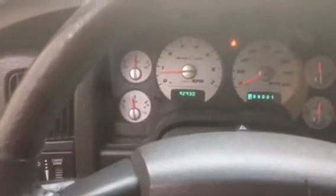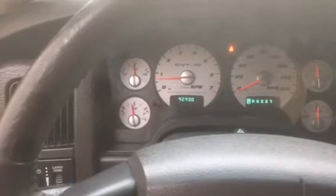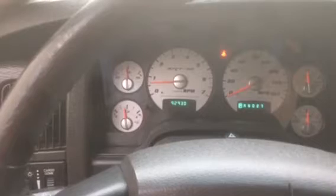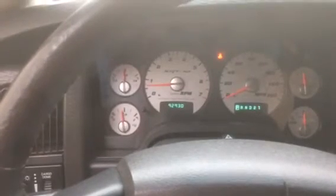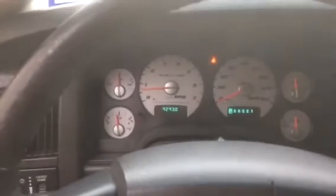Hey, it's Scott with MS1 Racing here with Rene's 05 Silver Bullet Quad Cab. We just put a stall converter in it — a 3200 stall. We made another video showing you the launch, but we're going to make a video on the inside to let you see how the RPMs can flash and build up power into the torque band of the engine before launching, versus taking off at 1,200-1,500 RPM and not quite so much in its power band.